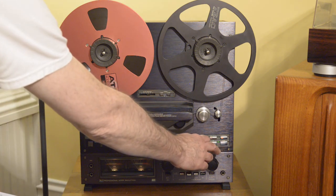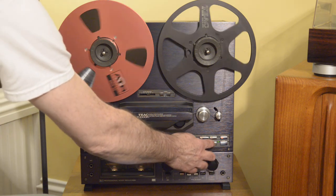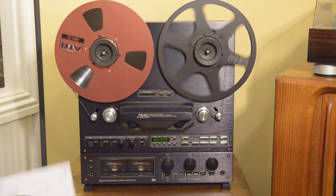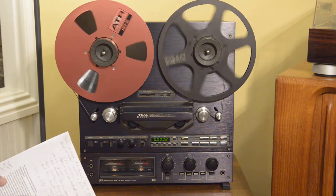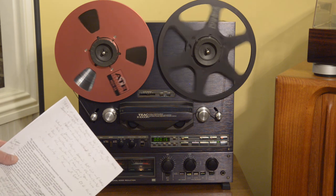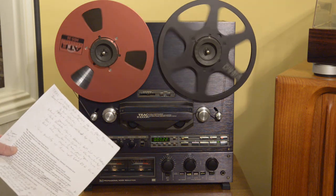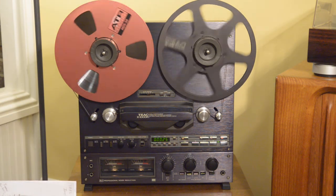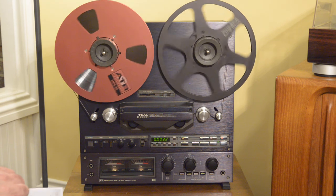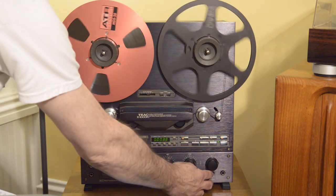Now that we're armed for record, just press play to get it back into the tape position. Which means now we're going to be actually listening to the tape. All reel-to-reels are basically three-head decks — erase, record, and playback. This being auto-reverse with all functions in both directions means it has six heads, so in reverse it does the same thing.